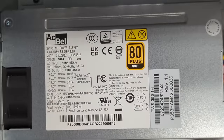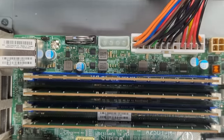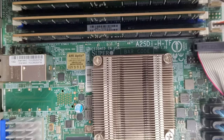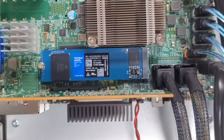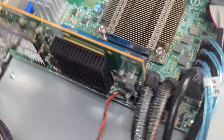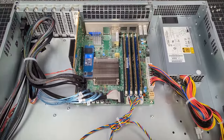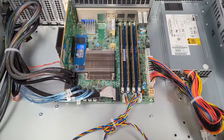It draws less than 170 watts fully populated under load. This is something not everyone takes into consideration for the small business market, where maybe they don't have dedicated higher-end circuits available to power all the equipment — especially when I mentioned the small business or YouTube market. This may be something that runs in literally a closet or a basement, and you don't want something high-wattage because you also have to deal with all the heat that comes with that, or if you have several other servers in there that may be a problem.